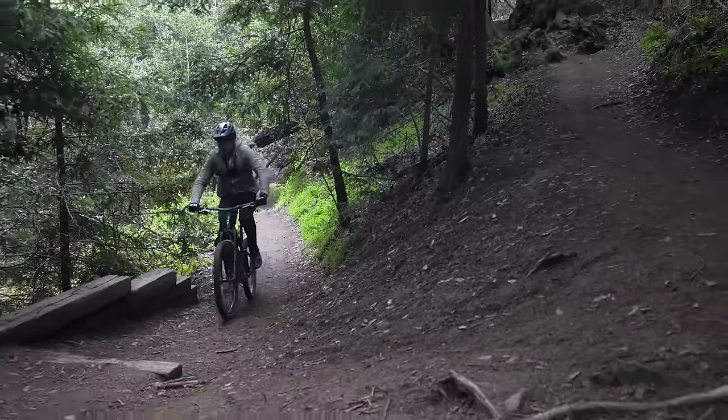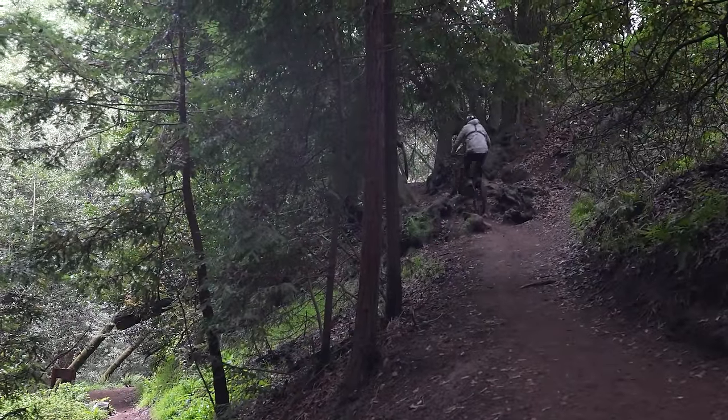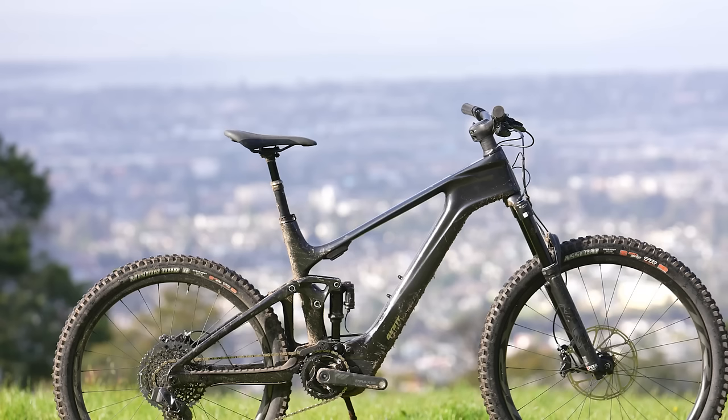Yeah, and I think a big thing to notice is a lot of these bikes behave differently if you're on a higher cadence or a lower cadence, if you're bogging down, or if you're not shifting appropriately to be in the right space for that motor. And it's a really forgiving system, right? If you're in too hard of a gear, it will help you get out of that. Maybe you might have to bump up to a higher powered mode, but it has that torque power delivery to get you out of that situation without having to drop a couple gears and break your chain on the way, or change the way you pedal.